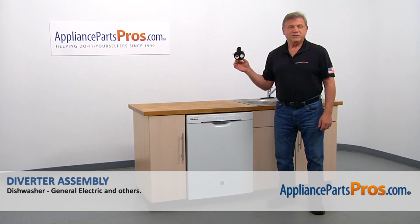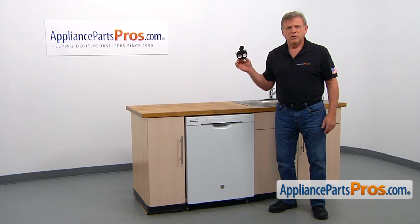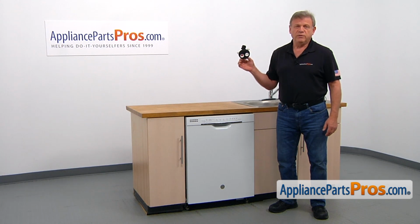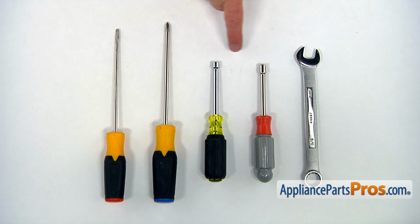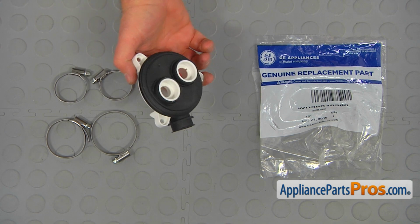In this video, we'll show you how to replace the diverter assembly in a GE dishwasher. It's going to be a very easy repair. Should only take a few minutes to show you how to do it. For this job, we're going to need a 5/8 open-ended wrench, 7mm and 1/4-inch nut drivers, Phillips screwdriver, and a long flat blade screwdriver.